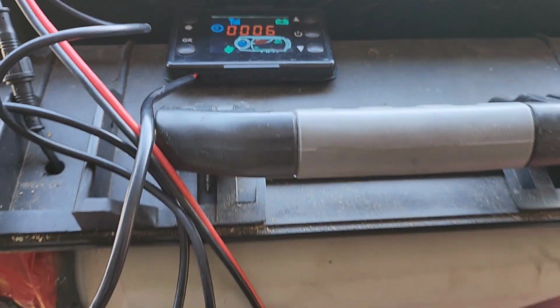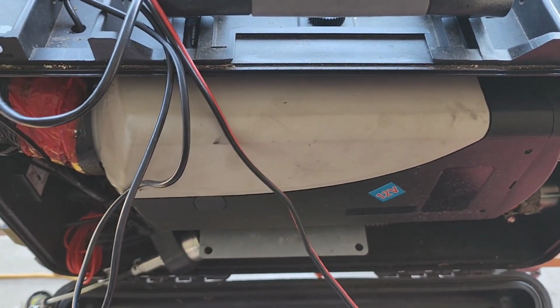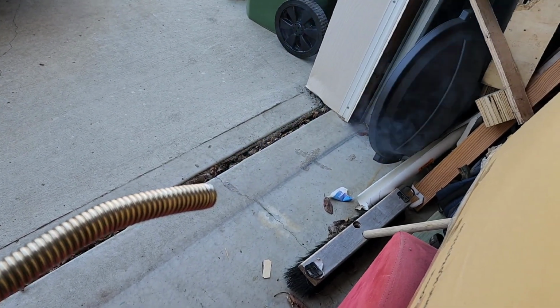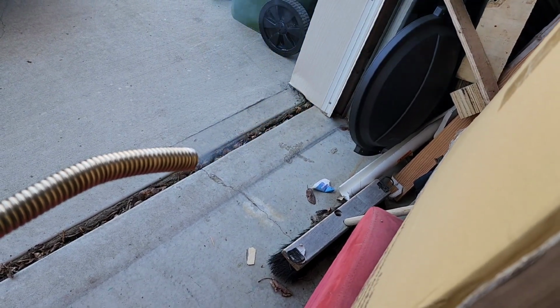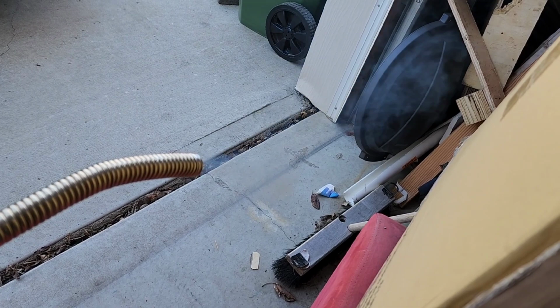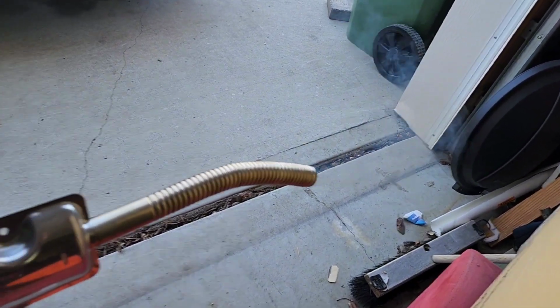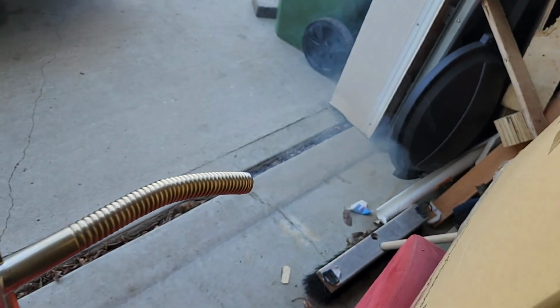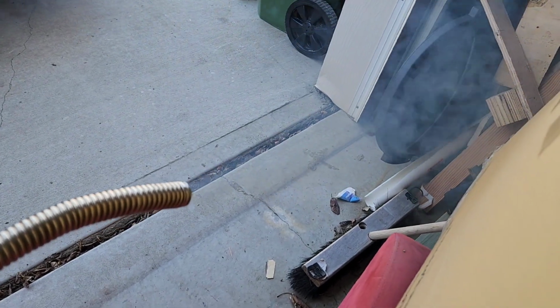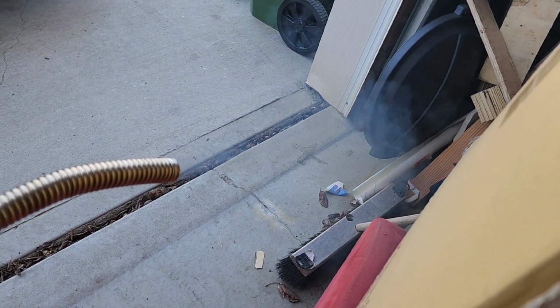There goes the pump. Should be firing up any second now. See some exhaust coming out. I suspect it's so smoky because I primed when it was already primed kind of from the filter forward, so I probably put way too much diesel into the unit, so it's got to burn that off.